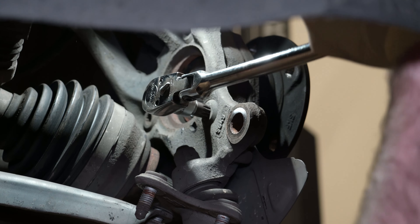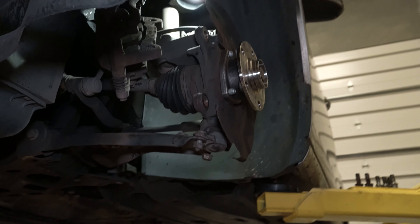With our old bolt, we're going to run it in and just pull the axle the rest of the way in. Make sure you have it splined first before you do this, and do not just run it home — if you do, you will regret it. Just let it pull in by itself. Make sure it's moving freely. Just got a little tap-a-roo.